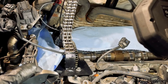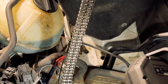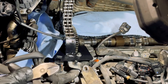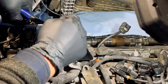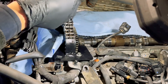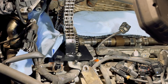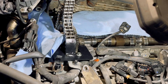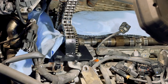I made some preparation — just using an aluminum arm to rest the chain on, and putting a zip tie on the other end of the old chain so you can hold it. Carefully rotating the crankshaft: I'm disconnecting the zip tie here and the zip tie over here, holding the old chain with my hand, and starting to slowly rotate the crankshaft carefully and slowly.